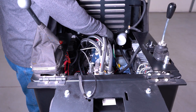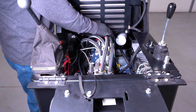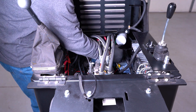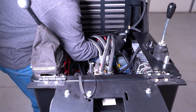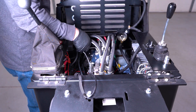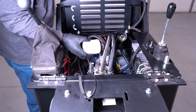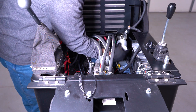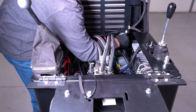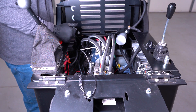I've got a drip pan in place with a couple of rags to catch any residue that doesn't make it into the pan. You're probably going to have to use a filter wrench to break it loose — I've already done that. We're going to remove the old filter, put a little bit of oil on the seal, screw the new one on, and get it tight — about a turn after it meets the rubber. Then we're ready to put oil back in.